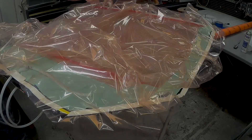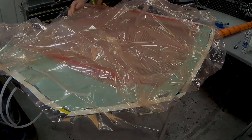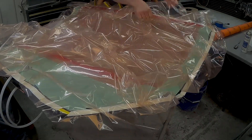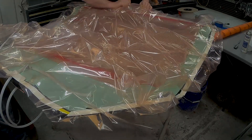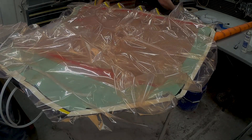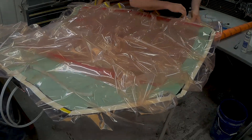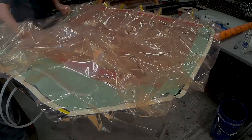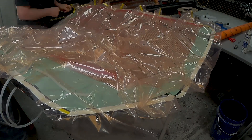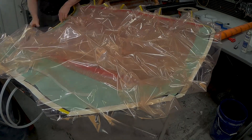We're putting it in now — this is wide material and you need a bag at least 20 to 30% larger than the mold. This is just a door panel, it's reasonably flat. I start with adhering the corners of the mold, and I'll show you this again with a couple of examples. Because of the nature of this mold and the way the shape runs, I'm just gathering up the material along that long bottom edge and making the length or the area of the bag match the area of the mold.